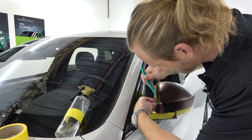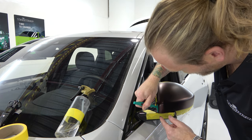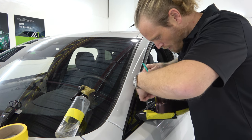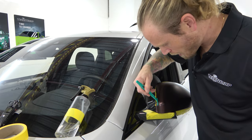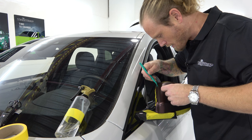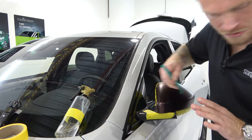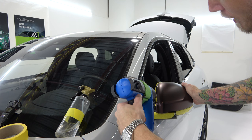I'm going to add a little bit of heat and get the film tucked into the edge with that heat on it. The film is shrinking into the edge once I add heat. Get this pre-tucked in here — take your time with the pre-tuck, you don't want to mess it up. Tucking tools can slide or slip. Add pressure and really take your time — this is the hard part, cutting it nice and clean. Now that it's in there, you can see that line is very definitive.